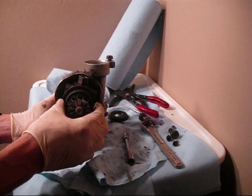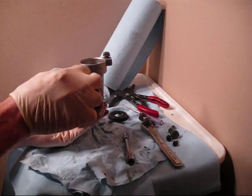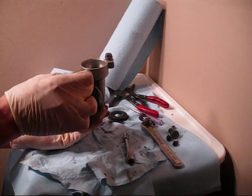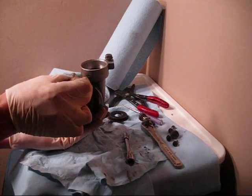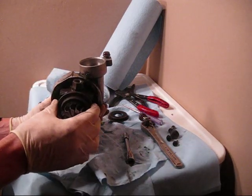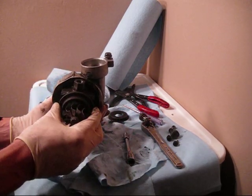To start off, on the top here is the oil feed line. You're going to unscrew that top bolt that sits on top of this piece — it's threaded onto the metal tube that comes down through. Make sure the metal tube isn't turning and just that one piece is turning, because you can twist and bend that line, and then you have to replace that.